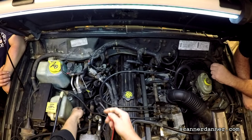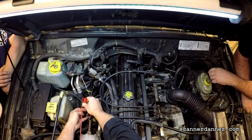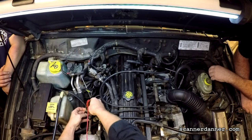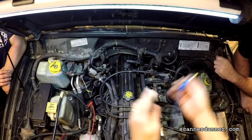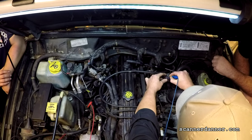When at all possible we want to use battery negative. I'm going to back-probe the cam signal on the harness side. When you're in there, it's just by feel - you can feel the metal pin inside. You have to be careful not to mess up a terminal. It won't shock you, but some components you back-probe will give you a little zing - a fuel injector or ignition coil primary can spike upward of a few hundred volts and give you a little pinch when you back-probe them.